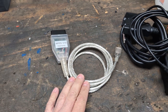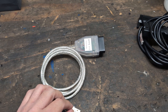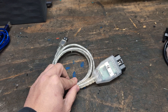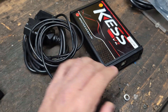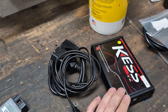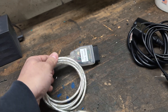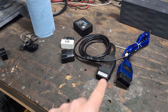Version 2 is faster to open up and faster to connect, but I have issues actually pulling the file onto the laptop, so I don't like it — even though it's significantly cheaper. It does work in a pinch if I needed to do it. Version 13, to me, is significantly better. It is slower, but it works every single time when I need to pull the file off the ECU. So this is my personal preference. This is how you tune your ECU when you have a file, and this is how you read and data log everything else.